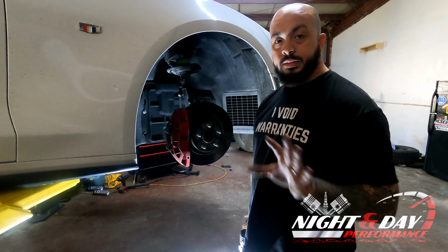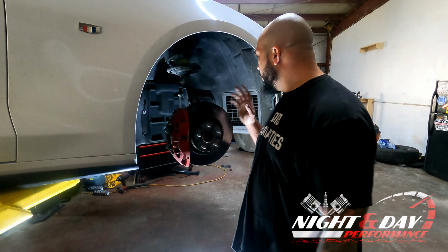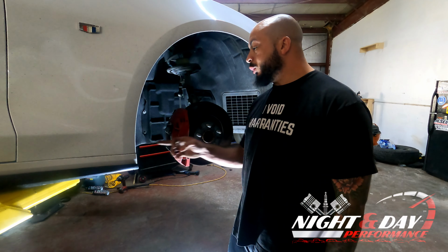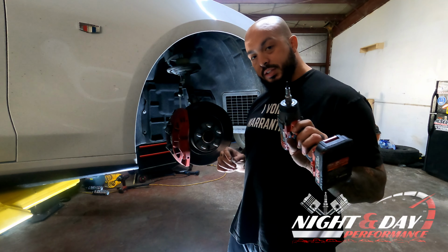Alright, so the next part is entirely up to you, whether you want to take the entire thing off or just part of it off. Here we're in the wheel liner on the passenger side. You're going to need a T15 and a push pin puller to remove the push pins that are throughout. Where there are no push pins, there is a T15.